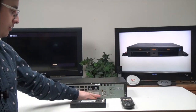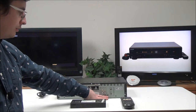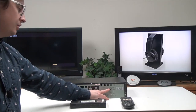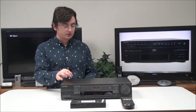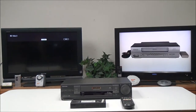On the rear panel you have your line input for recording onto VHS and then your line output for playback. You have hi-fi for both, and then you have channel 3 and 4 — you may need to change that depending on how you have it connected. Then you have your RF tuner input and output right there.